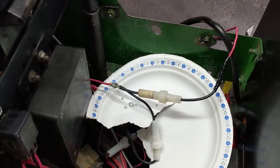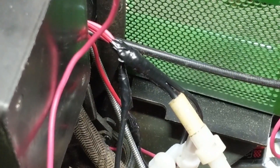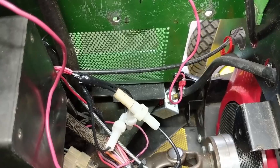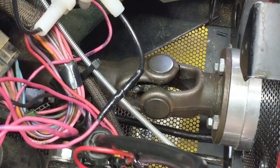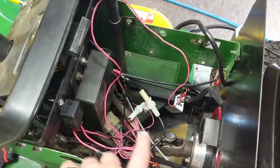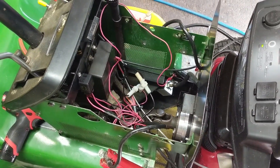I let that cool and wrapped it up with some electrical tape — I ended up wrapping the splice in quite a bit of electrical tape. I now have the fuse wire going all the way back down to the fuel pump. When I come over to the key switch and turn it on, you guys can hear the fuel pump turns on, and when I shut the key off, you can hear the fuel pump shuts off — everything is working as it's supposed to. Because there's quite a bit of loose wire and I do not want a wire wrapping up on that universal joint on the driveshaft, I'm going to bunch up the wires and zip tie them somewhere out of the way. Then once the wires are cleaned up, I'll reconnect the battery and take this thing outside and fire it up.